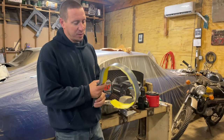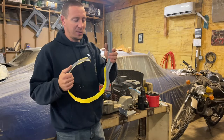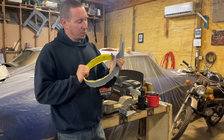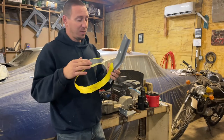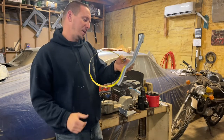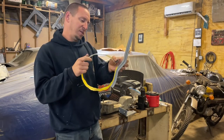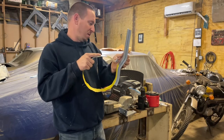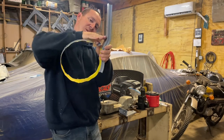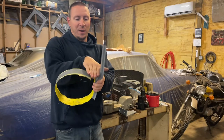So on the next episode, a couple of things I would like to get to. I don't know if we'll make it. These are my fuel tank brackets. And I didn't measure real close when I was mocking these up months ago, a year ago, whenever it was. The stock Freightliner air tanks have like an 8-inch diameter. Problem is they're like this long, so that's too short, which puts it like here. And the way these tuck up in the frame rail is like right here. So they clear just fine on the bottom of the frame rail, which is about where my hand is.